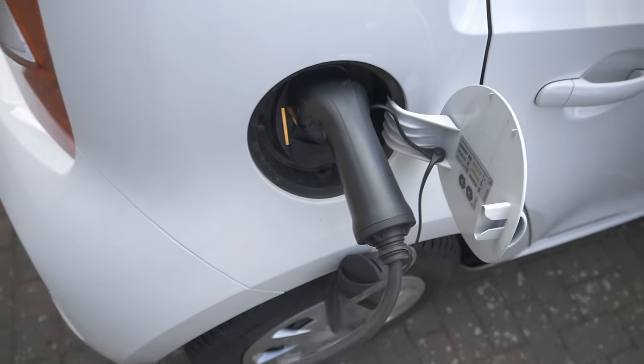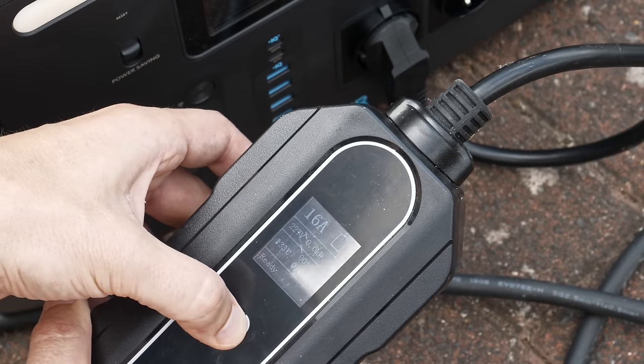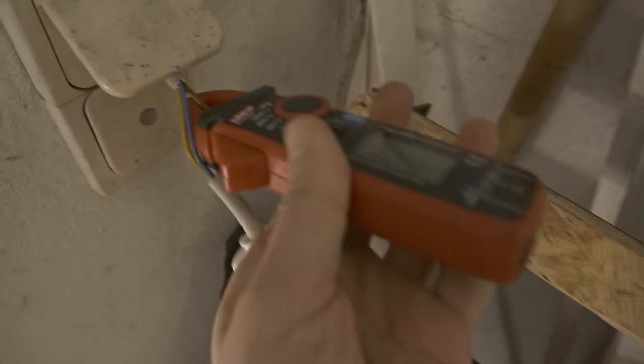So I thought, why not use the AC charger during good weather to recharge the car? The problem is that the 600-watt limit basically limits the amps I can put into my grid. I was able to measure about 2 amps after all the conversion losses. But AC chargers have a current specification and the lowest you can go is 6 amps. Most chargers wouldn't even go lower than 8 amps, but I was able to find this one on AliExpress.